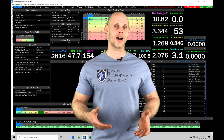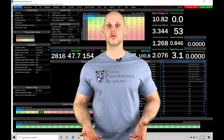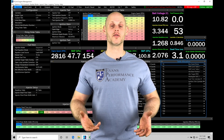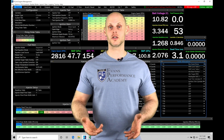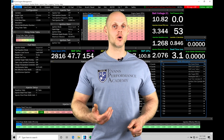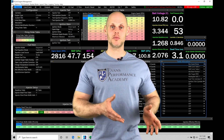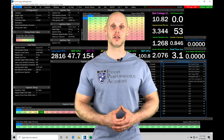We're going to walk through how to set up your vehicle speed sensors, going through the different sources between the driven and undriven wheels, and then taking a look at how to calibrate our gear ratio calculation if we're referencing things based on gear position. If we want to do boost by gear, a fuel or ignition correction based on gear, or any kind of gear cuts, we have to know what our gear position is going to be, and we have to rely on our speed sensor being calibrated properly. We're going to go through how to set up speed and gear in this video.